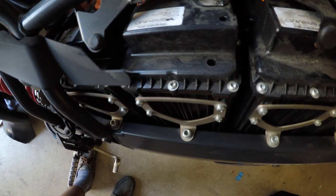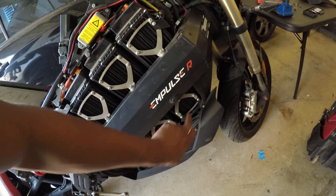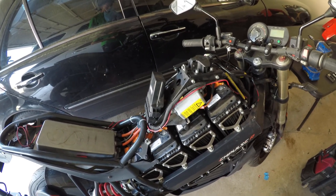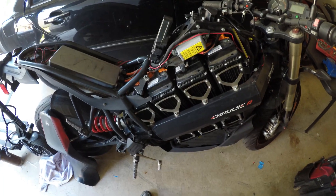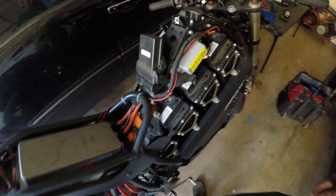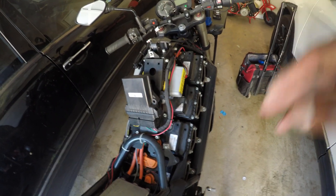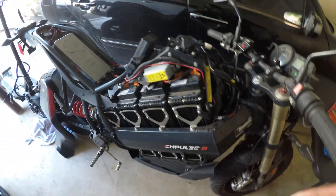I don't know the exact specs of this, but I actually have it right there. It's a 14 volt nominal — so roughly 15 volts for each of these. And there are 7 of them. I'm glad that Brammo put this on there because 15 times 7 gives you 105. So basically all I have to do is charge these to 15 volts. I'm going to look at the individual voltage and get some of this stuff taken apart. I'll give you a time lapse of how I remove some of this.